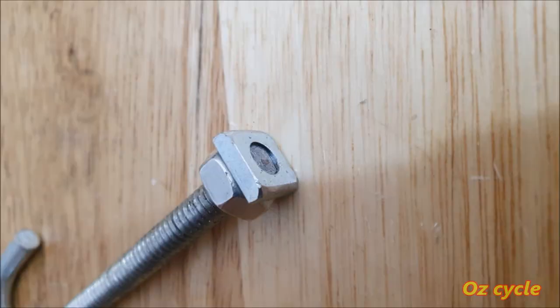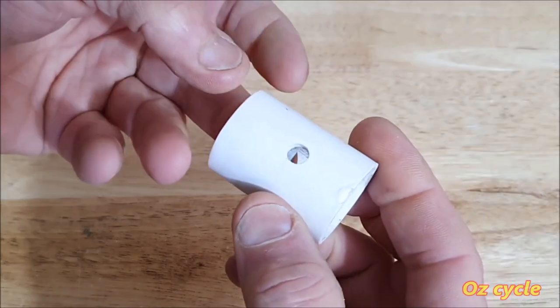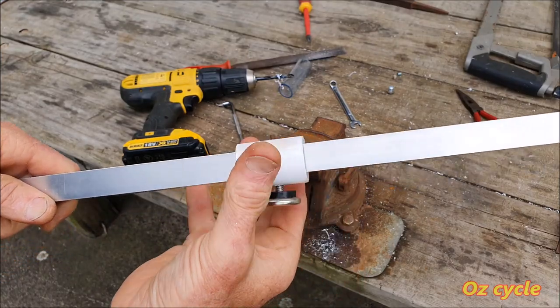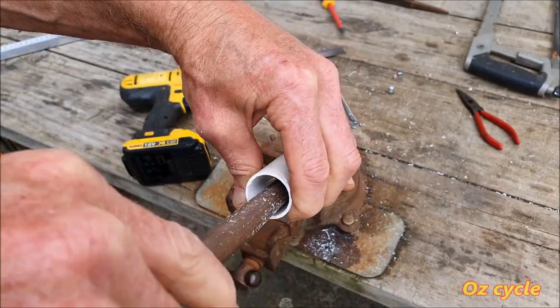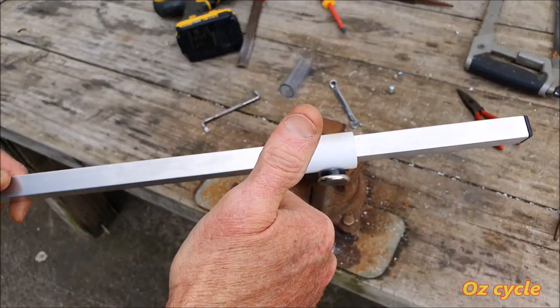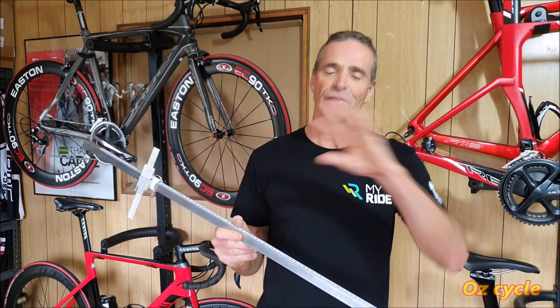Hold the coupling so the holes are horizontal, then mark the clear plastic tube at the height of the hole, drill with a small bit then a slightly larger bit so the bolt just fits through, and do the same with one of the holes on the coupling. Turn the coupling over to the other hole, secure it in a vice, and drill that hole slightly larger until the thread on the knob fits through nicely — the thread needs to be 10 millimeters long, so cut it if longer. Bevel two edges and the four corners of the nut, lock it onto the J-bolt and file the edge. Insert the nut into the coupling with beveled edges facing inward and lengthways along the rod, loosen the knob, and insert the rod. We're halfway into making the tool — to finish and show how to use it, we'll do that in the next video.